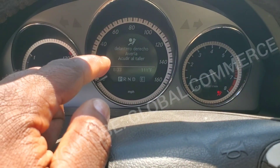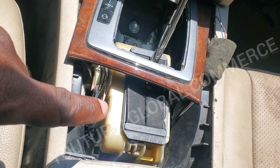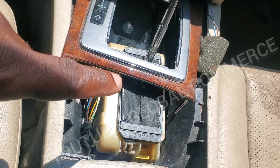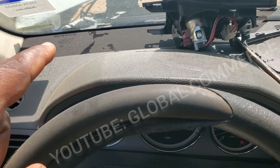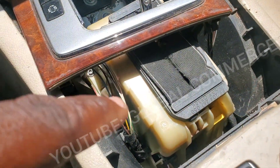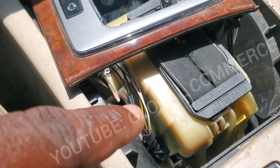The ECM and transmission is showing no communication with the N15. This should be on the CAN network and my scanner is also unable to communicate and connect to it. There's fuse number 16 in the fuse box up front — I checked that, it's got power, I believe it's a 5 amp fuse. So the issue is not that. We've got to investigate more — whether this module is bad or if it's a cabling issue.